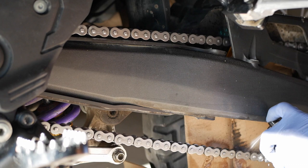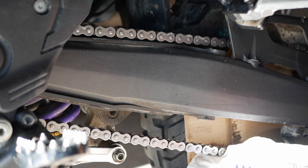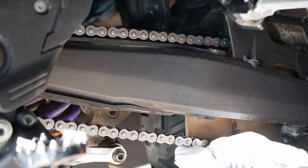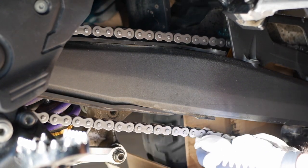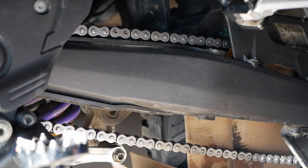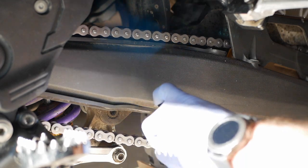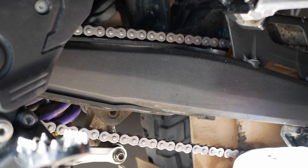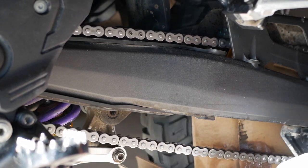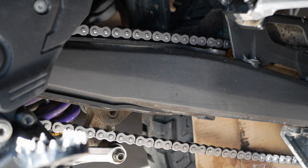Sometimes the lube goes everywhere, so it can help to put a little bit on your rag and apply it on the bottom that way as well. You can spray on the top but I don't like it because you get grease all over the bike. Or you can do it at the sprocket — just cover that section and spray it on the back of the sprocket. I like to have the grease only where I need it, not all over the place — so it's not dripping and you don't get a build-up from the chain lube.